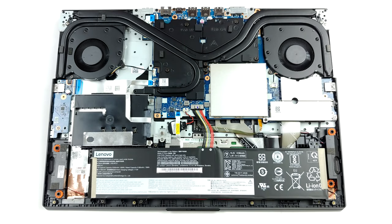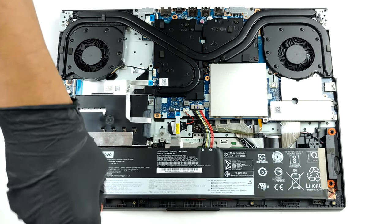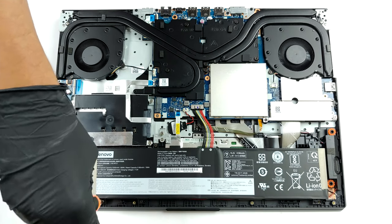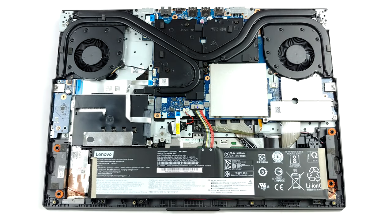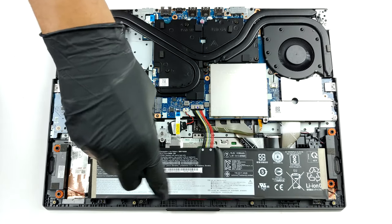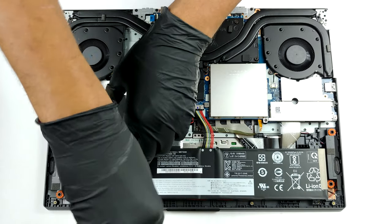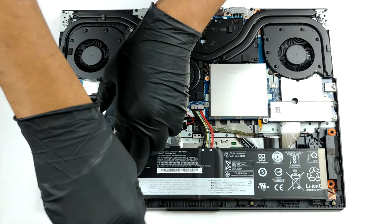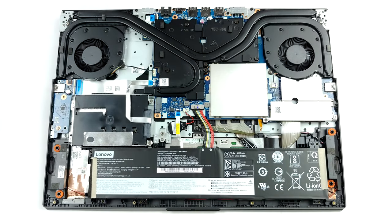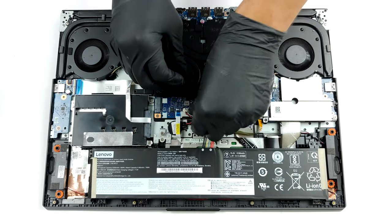Next comes the upgradability. In this case, there are two RAM SODIMM slots, hidden beneath a metal bracket. They can hold up to 64GB of DDR4 memory, despite Lenovo officially offering it with only 16GB. Additionally, the RAM installed here is 3200 MHz but will run at 2933 MHz on the Core i5 and the Core i7-10750H models. And in terms of storage, you get one M.2 PCIe x4 drive slot and a 2.5-inch SATA drive bay. As for power away from the plug, you get an 80 watt-hour unit.